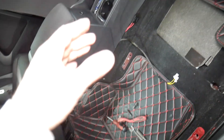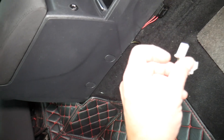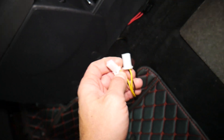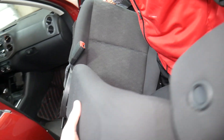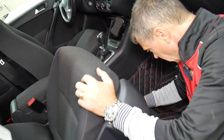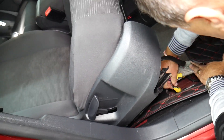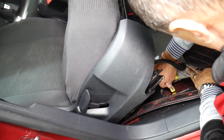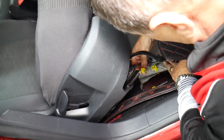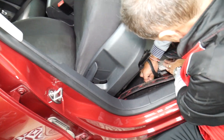Make sure you have the right wires — in our case, the right seat wires and the left seat wires are separate. You can turn the ignition on, switch on the heated seat, and measure with a voltmeter to verify 12 volts; if not, swap the wires. When reinstalling the seat, be careful not to scratch anything — those rails can scratch easily. Make sure it doesn't fall on the cables. It's always recommended to remove the battery for at least one hour before removing seats, and it's critical to know which battery terminal to disconnect or reconnect first to avoid burning modules.